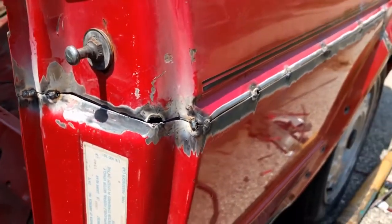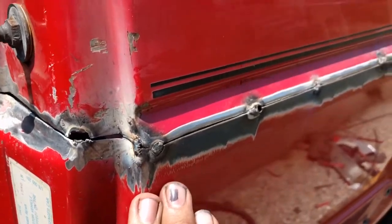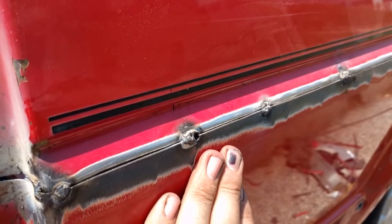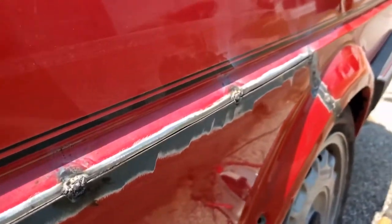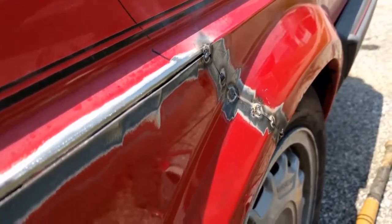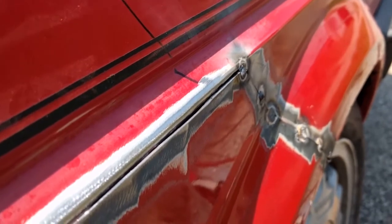And then this sheet metal along the side, I would hold it where I needed to hold it, put a tack. And then I'd move a little ways down, hold it into where I needed to hold it, put a tack. And I just worked my way all the way around, and especially right here, because there's some complex bends, I start at the top corner so that that corner stays where it needs to.